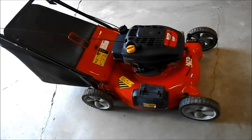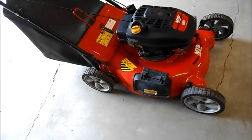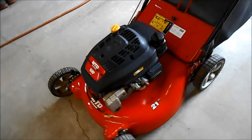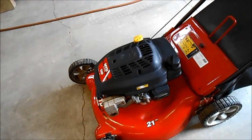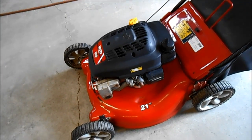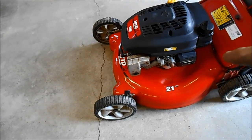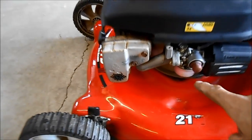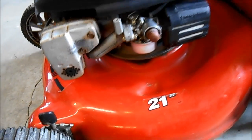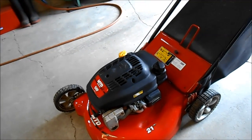Okay Tubes, this is what you call making a silk purse out of a sow's ear. Looks a lot better, doesn't it? I'm really happy with how it turned out. Since I saw you last, it's got brand new oil in it — I flushed the gas tank. I just checked the carburetor bowl; I took it off and it was whistle clean inside there, so this old mower hasn't gone very many hours on it. I cleaned the spark plug and wiped it down.